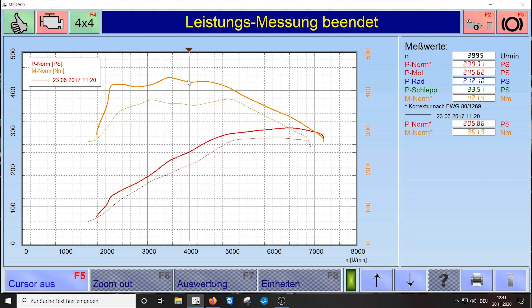The valve lift change is also why we have more torque at lower RPM with a different lobe profile compared to the top RPM range. At the end of the power curve you can see 270 horsepower for the MK6 compared to 300 horsepower for the MK7 — that's nearly 40 horsepower more. Keep in mind this is just Stage 1, with maybe some spark plugs, coils, and an intake filter — things you can change yourself — plus just the first step in ECU chip tuning.